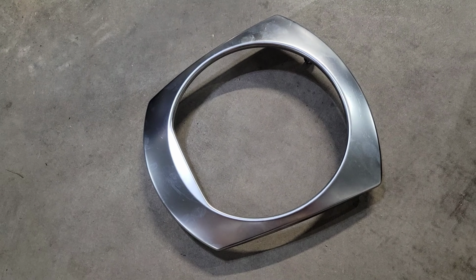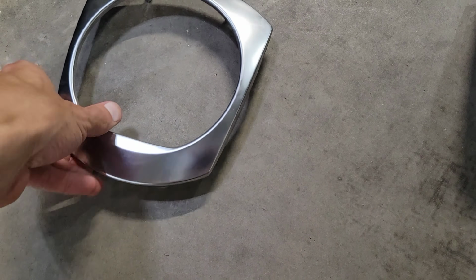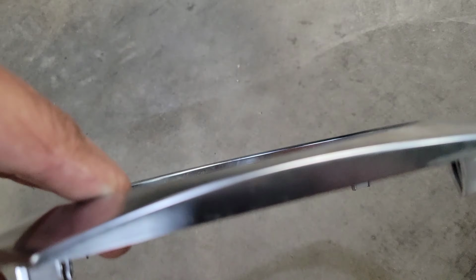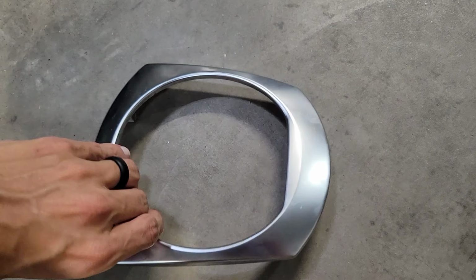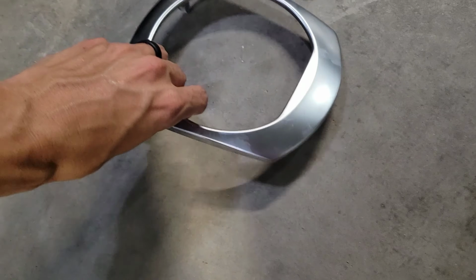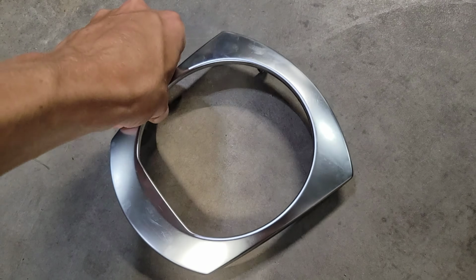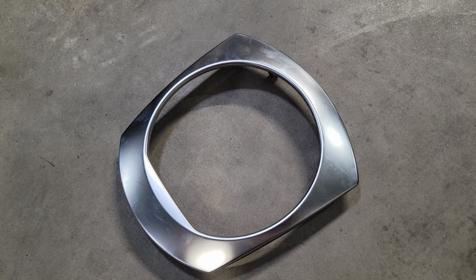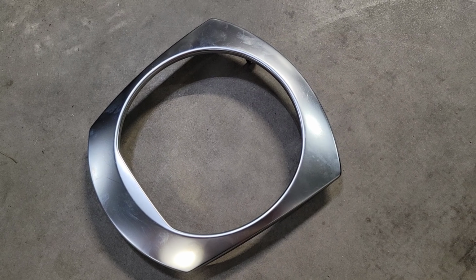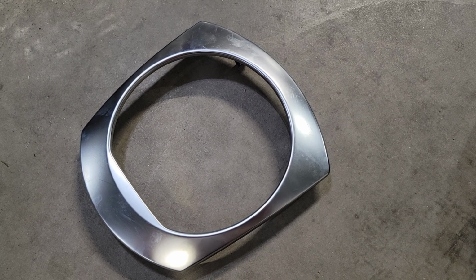So now I'm going to go and prep this surface. I'm going to use some rubbing alcohol or isopropyl alcohol to completely clean the surface up. You can see the edges actually show a little bit of dirt and grime. And so we're going to get this nice and clean, remove all these fingerprints and things from it, and then we can start cutting the vinyl to form. That way we can start working it onto the trim piece and hopefully get this thing wrapped up.